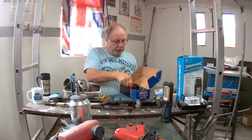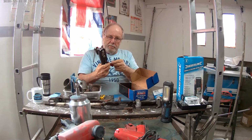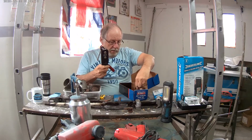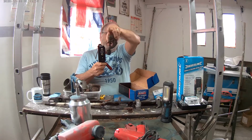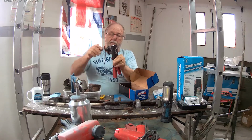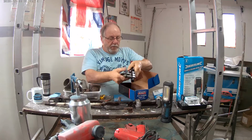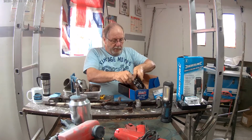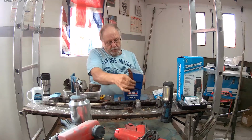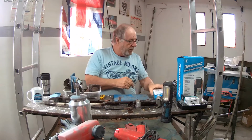So, here we are, one of the best tools, heavy. It is a brake pipe flarer. Basically, you cut your pipe to length on the car, which allows you to do it on the car. You grip it, put the collet in, and you've got your brake pipes done. Very good tool. When you've had one, you'll rue the day you never had it. It's a great tool.